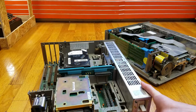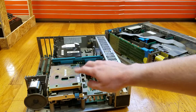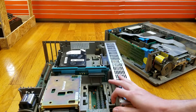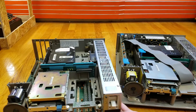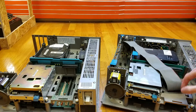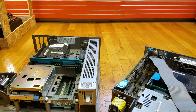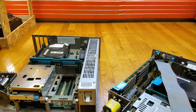Other than that they look pretty much the same in the front. We've got our speaker up here, the CMOS battery, and two floppy bays. If you look at this floppy bay you can see our memory down in here, and the one extra slot which is unused. On the Model 50 you'll notice that is not the case — that's covered up. The reason is that the Model 50 does not allow you to upgrade the memory. This model came with 1MB of RAM and that's all you could get on the motherboard. If you wanted more than that, you would need to use a RAM expansion card. I've got a RAM expansion card in here which has 2MB on the card, and that was the only way to upgrade the memory for the Model 50.